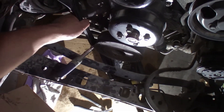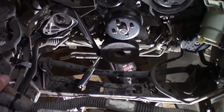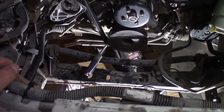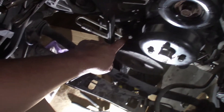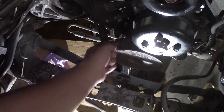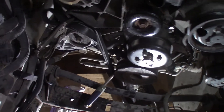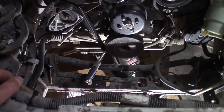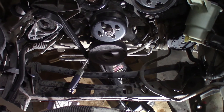I have an old belt on here that I've strapped down with vice grips on both sides just to hold it — to get the crank bolt out and also to install it to spec. One thing you want to pay attention to is the crank sensor right here. Be careful with that because most of it is plastic, and if you hit it you're going to crack it and end up buying a new sensor.